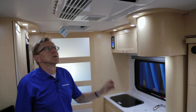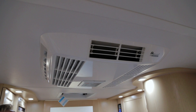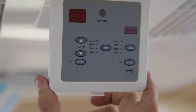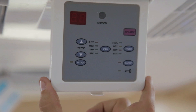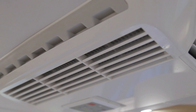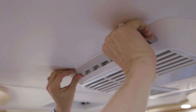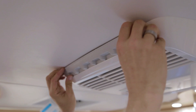Your vehicle is equipped with a 13.5 rooftop Atwood Air Command air conditioner. It has an inner shroud with a control panel and remote control — you can select temperature, on/off, and sleep mode. Refer to your Atwood manual for full instructions. This air conditioner requires a 110-power source, operates off your generator or 30-amp shore power, and draws approximately 13 amps. To keep it running efficiently, clean your filters regularly — simply lift and pull them from the side compartments, one on each side of the inner shroud, and push back in to lock.